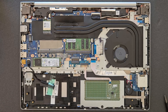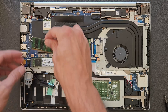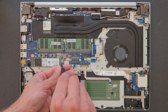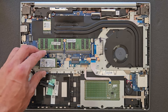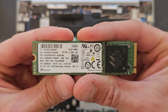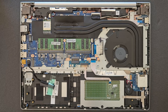That first stick is in, and I'm gonna take the second one now — same one, 16 gigs, DDR4. I'm gonna leave links in the description, so if you're looking for a similar one, I'll also leave the faster option there if you want faster RAM. There's your M.2 drive. The current drive is fine, it's just not the biggest — 256 gigs — so I'm gonna install a one terabyte.